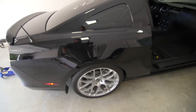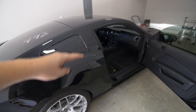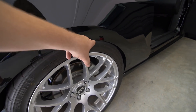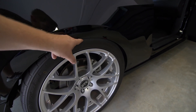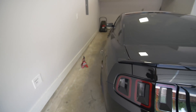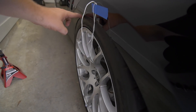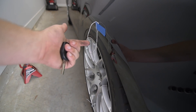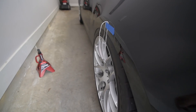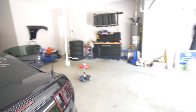Another easy way for me to tell if my rear end is aligned — I have the airlift system so I can slam it and see where the tire sits inside the fender. Mine does touch a little. Air it out, go to the other side and it looks even. Before, you could fit more of your finger in between on one side because the rear end was pushed that way. I think we're pretty well aligned. This is a cheap trick to do at home with the string, nuts, and tape measure and it works out pretty well.